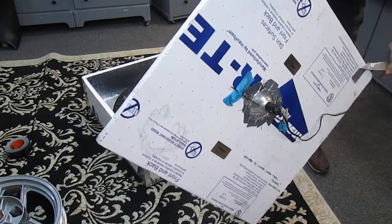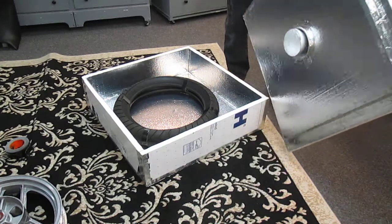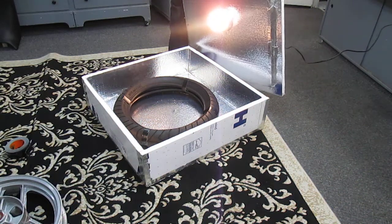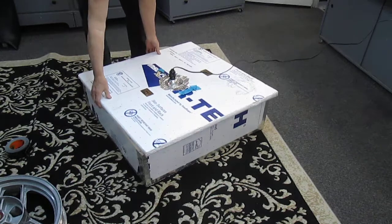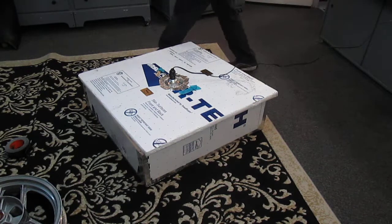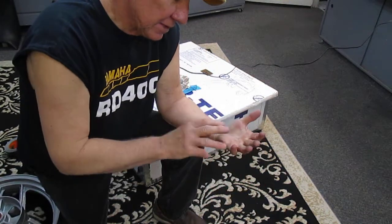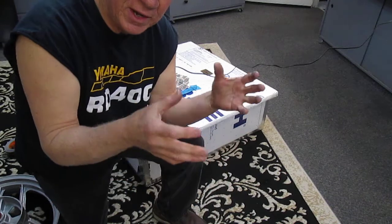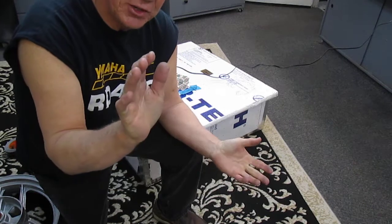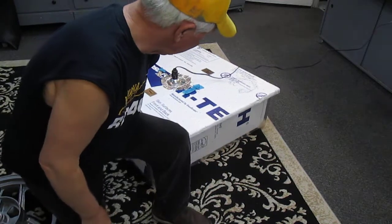Mark was the last one to have the box, so I hope the bulb still works. Bulb is tight. If I were to check over the next 10 minutes with a digital thermometer, I'd find that tire is going to get to 70, 80, 90 degrees — at about 120 degrees it gets nice and soft, and at about 140 degrees that tire should mount right onto the rim as soon as I put the air in.